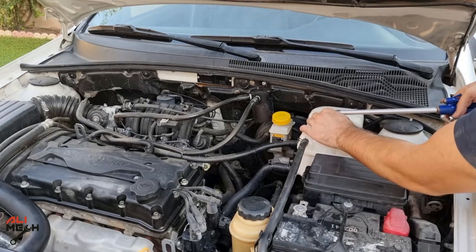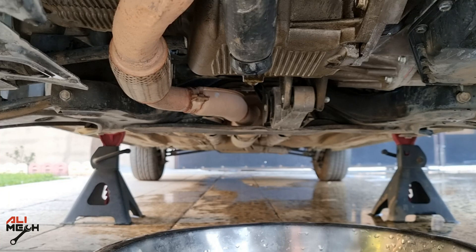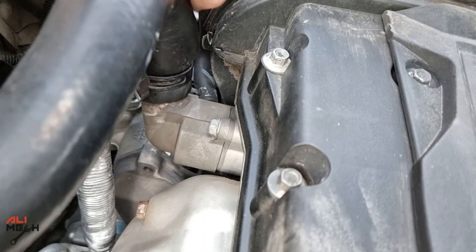Next, I'm going to use compressed air to push all the remaining water out. It's not necessary, but if you do it you will have a more accurate coolant ratio without mixing with tap water. Finally, we're going to put the inlet hose and the outlet hose of the radiator back on the engine.